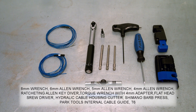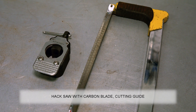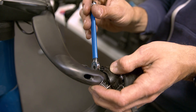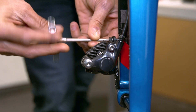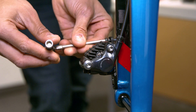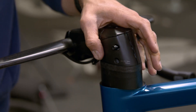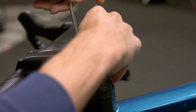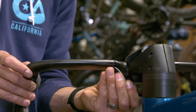These are the tools you'll need to complete the following tasks. To start, disconnect the front brake hose from the lever, then loosen the two bolts of the brake caliper so that the caliper hangs freely from the fork. Next, loosen and remove the three bolts located on the right side of the stem, then loosen and remove the bolt of the top cap and set both pieces aside.